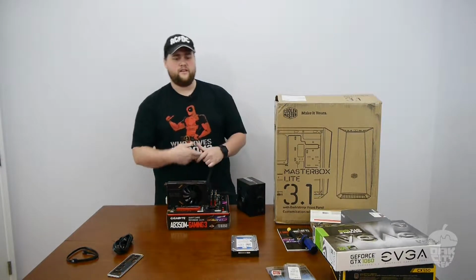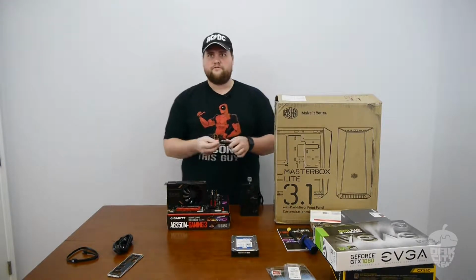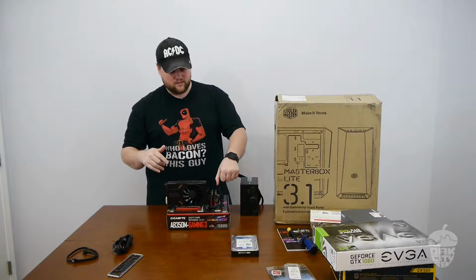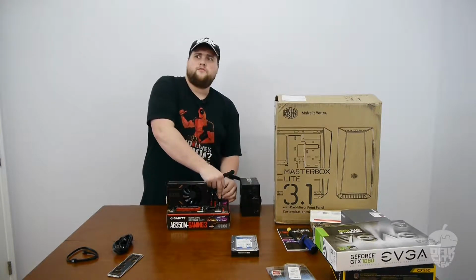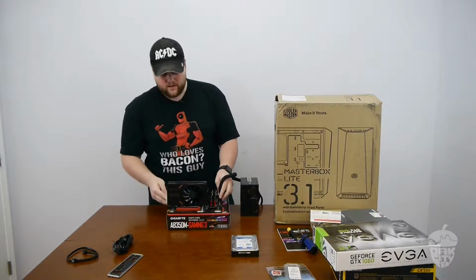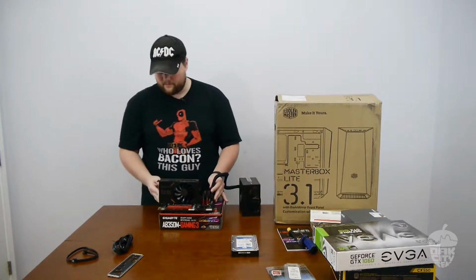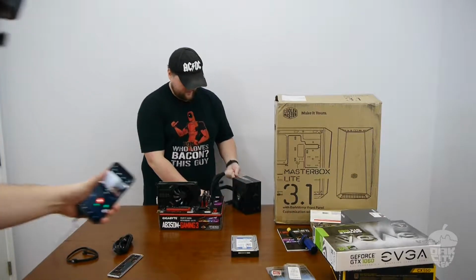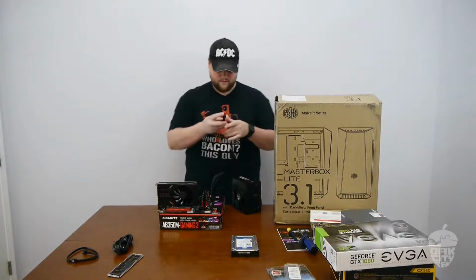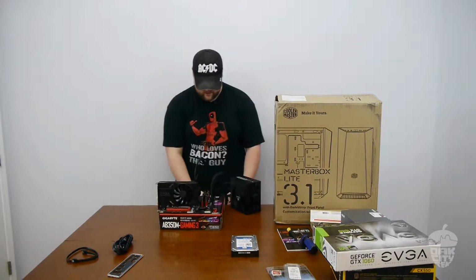Sorry, basic question. What does that mean? Oh, NVMe is a new bus for solid state drives. It uses up to 4 PCI Express lanes, so you can have crazy amounts of speed. It's like 5 times faster. So when he was saying this is a SATA version, this essentially uses the same protocols as one of the box SATA drives to communicate with the motherboard. NVMe uses a different version to communicate with the motherboard that uses PCI Express rather than SATA.